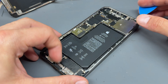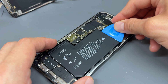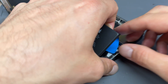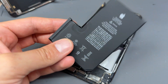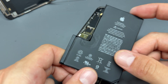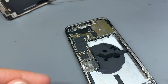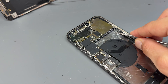Now you've got a couple of options. You've got these little pull tabs that you can try to pull out. However, if you get a plastic guitar pick, you can just have a little pry at it and you'll find that it's a lot easier. Get a pry tool under it as well if you want, and you'll get it out much easier than trying to mess around with those pull tabs — because those pull tabs, quite frankly, do not work. Anyway, the battery is safely removed. Dispose of it using your local recycling instructions.